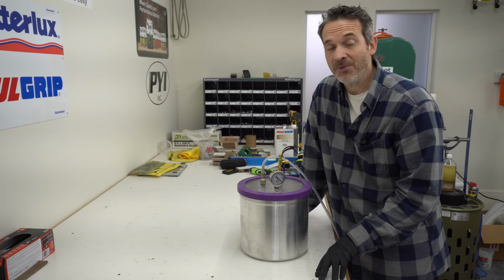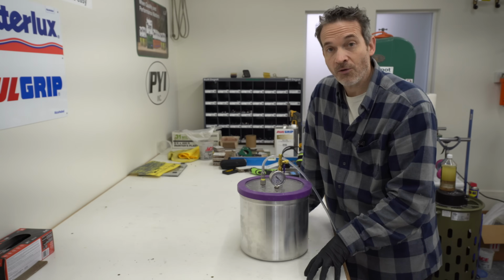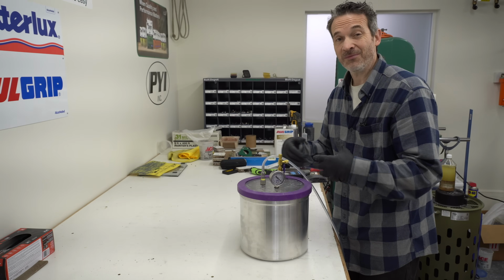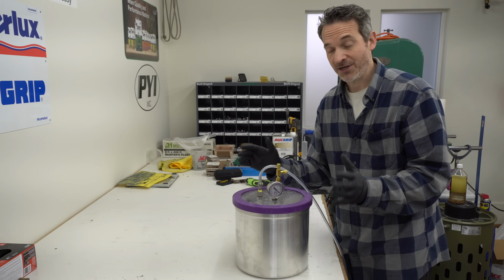That's going to be a lot harder, but I do know a few people that have managed to accomplish this by putting ports in along holes on the top of the deck and pulling the vacuum and watching the moisture decrease over several days. Temperature is going to be your friend here, so you're going to want warm days for that.